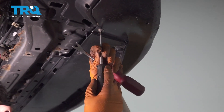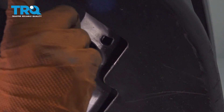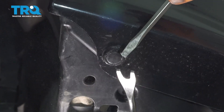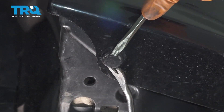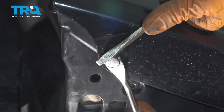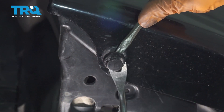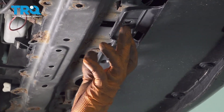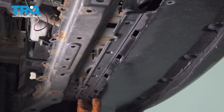You also have to take out a Phillips head from underneath. If you follow the bumper cover along, you'll see a push clip over here. Most likely these push clips underneath are going to be extra stuck because of sand and debris that makes its way in there over the years. There should also be three push clips along here — one on each end and one in the middle. Mine are missing, but if you have yours, they should be there.